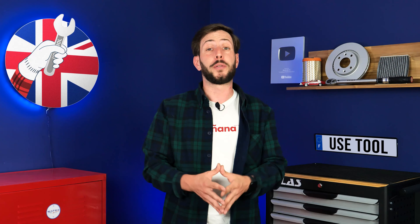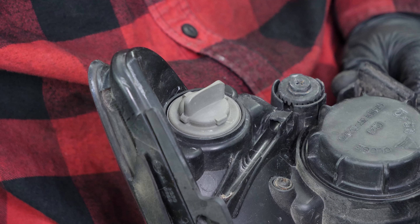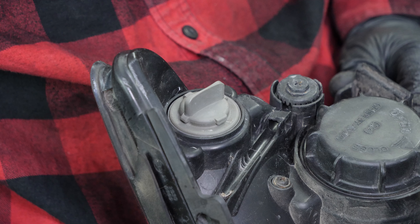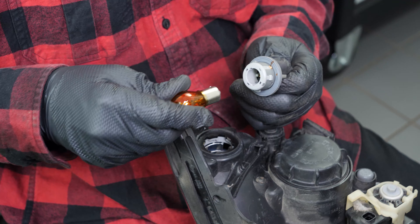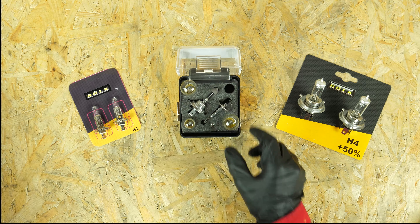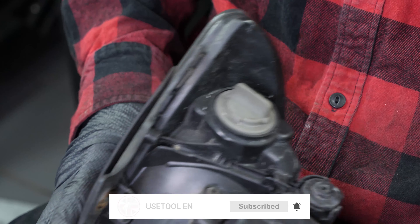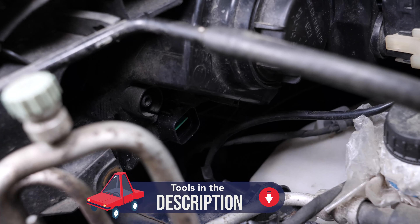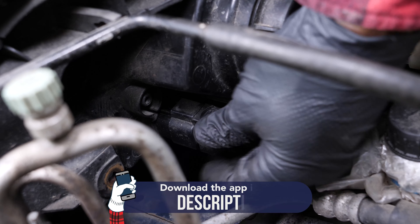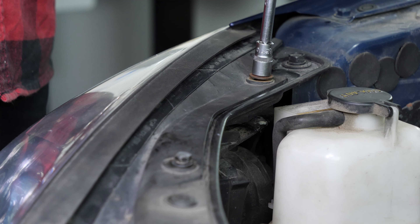If we can share this video and help you save money, it is thanks to our partner Mr. Auto — if you want to support us and buy the parts for this operation, visit their website. Back to work: to replace the indicator light bulbs, make a quarter turn anti-clockwise holding the grey cap, then remove the whole thing. To remove the bulb, press on it and make a quarter turn. Take the new bulb and do the same in reverse when putting it back in. Reconnect the electric connector, put the light back in its housing, reconnect the second connector, and screw the three screws holding the headlight back in place.